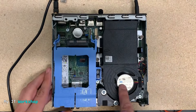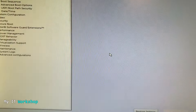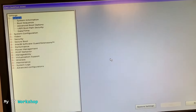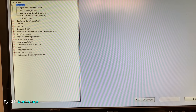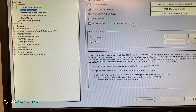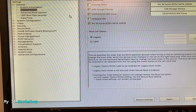I'm going to connect everything back one more time. You can see the fan spinning but it's not on yet. Allow me a few seconds for the camera to adjust. I'm going to press the power button, and now I'm going to press F2 to access the BIOS. We've confirmed it's working — we don't see the password message anymore. You can see the model: Optiplex 5050.